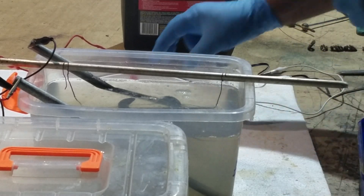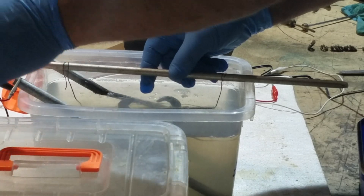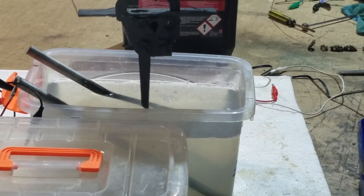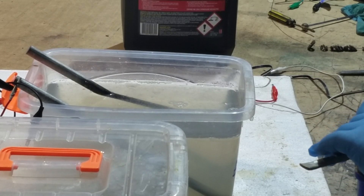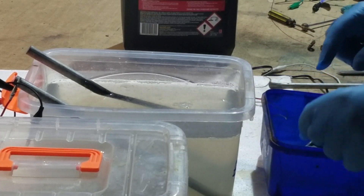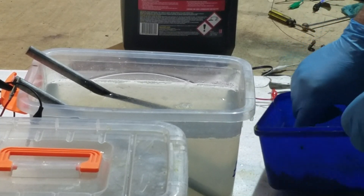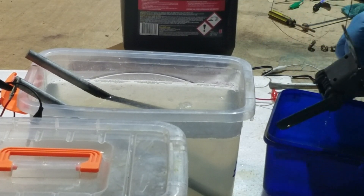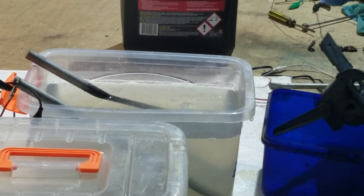Try as I might I have not been able to achieve a gloss shiny finish, but I am getting a good heavy durable rust-proof coating, and for a Land Rover that's what I'm looking for. The battery charger is allowing me to do large parts like this by having an electrode on each side, which means you get better coverage. I'm sticking my neck out a little by trying to take on such big items with such a complex shape, but with two electrodes and plenty of volts it's doable.